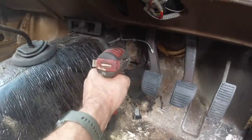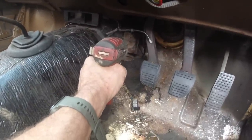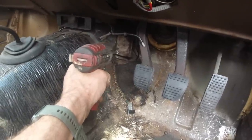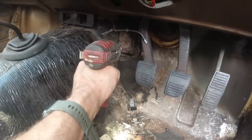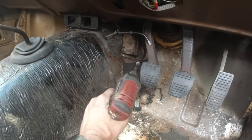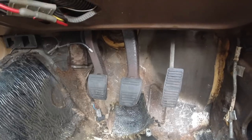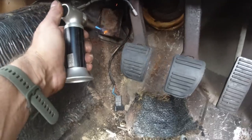Then push as hard as you can, really push as hard as you can, so you've got maximum force pushing on the screw, and then it'll hammer. It won't turn straight away, it'll give you the ba ba ba ba, and if you keep hammering away, each impact will break that screw down. If you're finding you're still struggling, if you can move your sound deadening out of the way, you could always heat the head of the screw up,